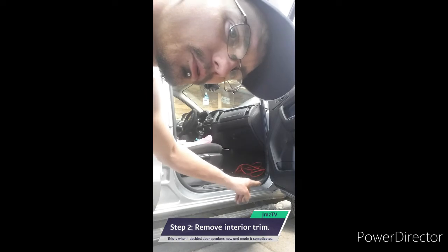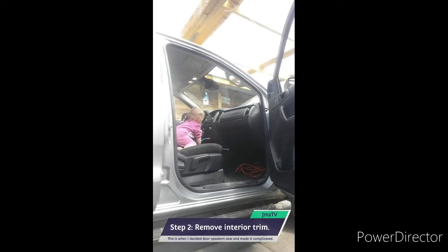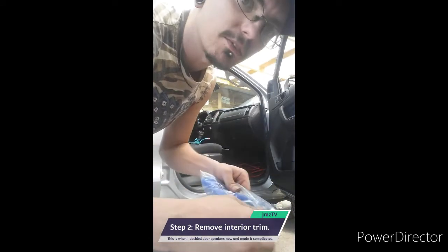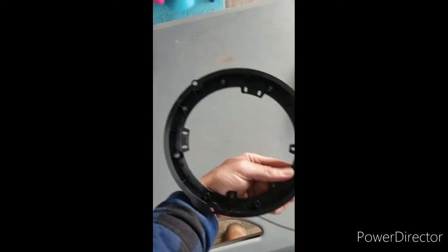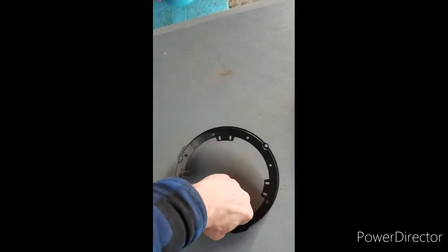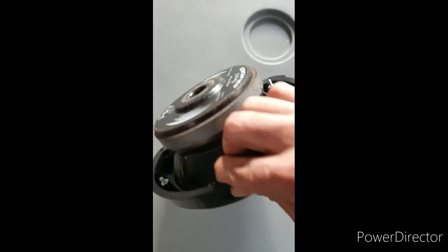Wires through the hole. Let's pull up some plastics — I paid $11 for this kit for pulling plastic trim, let's see if it's worth it. Ford has a one, two, three bolt pattern to mount your speaker on. You've got to order these little trim rings. These inside holes are for five and a quarter — you break them off, quite literally break them off, and just shove your six and a half in there. I used nuts so that I could take them off and put them back as many times as possible, because I don't know how long these PRVs are going to last. But that's it — four more to go.